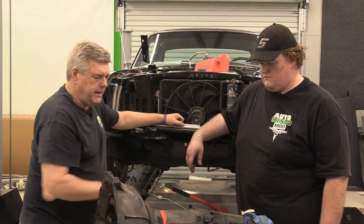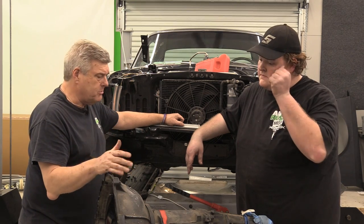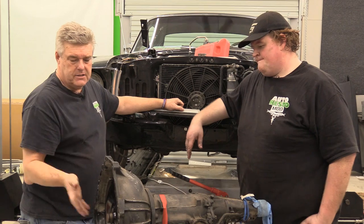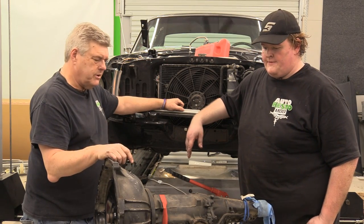So we're looking at a 1982 case, we think — at least the part numbers on the side indicate an '82. This will probably make a good transmission for us to go through and do a build on. It's got the B servo on it, which is supposedly the better servo for these — it's the big-body car servo. It might be a Performance Automatic build because PA usually does their transmissions in black, though I see no other indication of that. The torque converter looks fine, and this is a good candidate for a rebuild. It doesn't look like it was too badly abused — you might pull the clutches out and they're perfect. C4s are super easy; you can build one on the back of a truck.